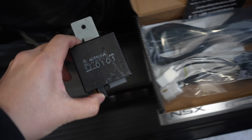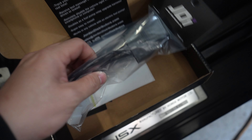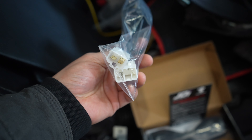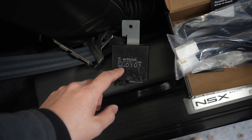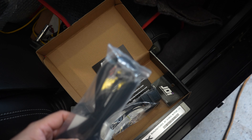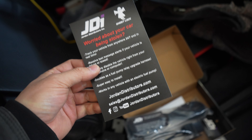We got the main relay out of the car — super easy; it's a 10mm bolt and then two plugs on the bottom and it comes right out. We're putting in the Jordan distributor adapter, which gives us a regular four-pin relay that adapts to the same two plugs on the OEM harness. We can also install a kill switch. For $70 you now have a simplified main relay, probably more reliable than this old unit — I don't even know how old it is; could be original to the car, so maybe 30 years old. We also now have the option to do the ghost lock, which allows you to remotely kill the car.